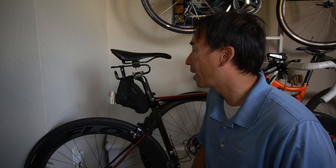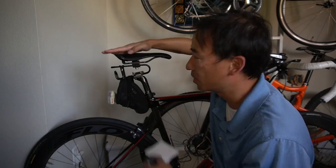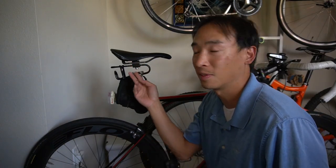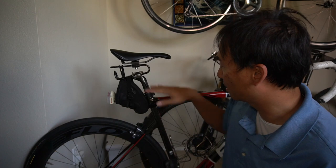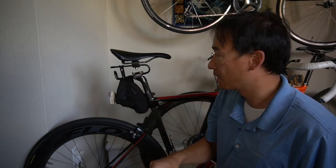It's actually been a few weeks since the install, so I've been on several rides and want to note a few things. First, if you spin in circles and pull up with your rear foot, it actually compresses the seat — so going up a steep hill while pulling up puts extra force on it. Second, on my second ride the bolt underneath wasn't tight enough, and there's no easy allen key access, so you have to loosen the rails, slide them all the way forward, tighten the bolt, then slide back — it takes a few minutes. Third, the seat bag sits quite a bit lower, which may be an issue on small frames.